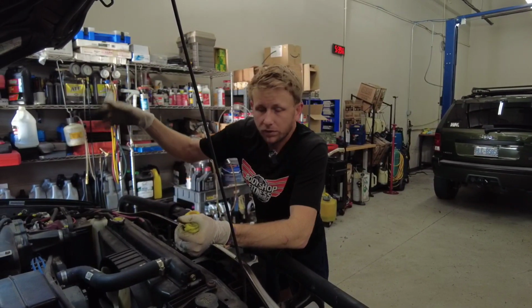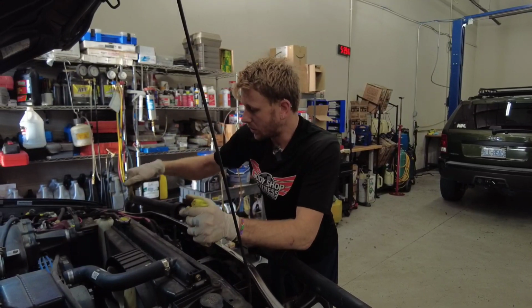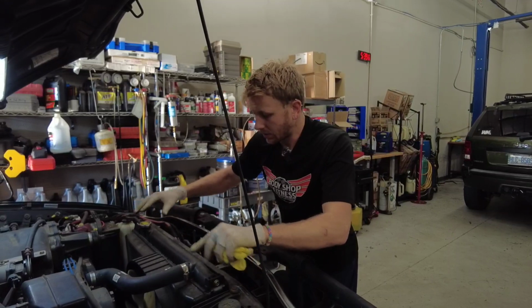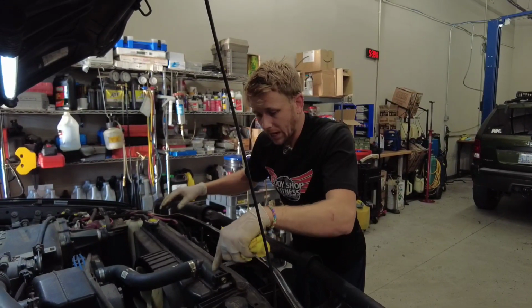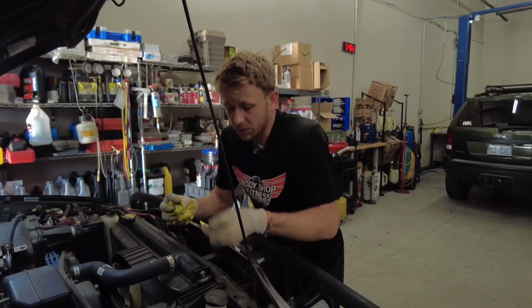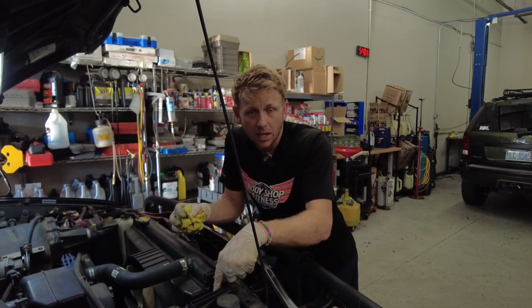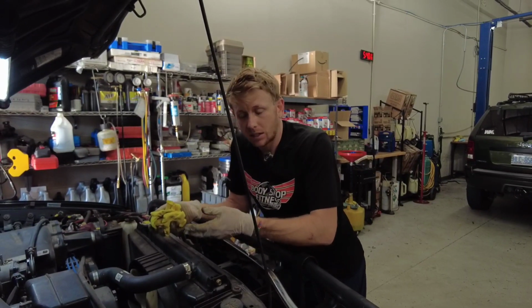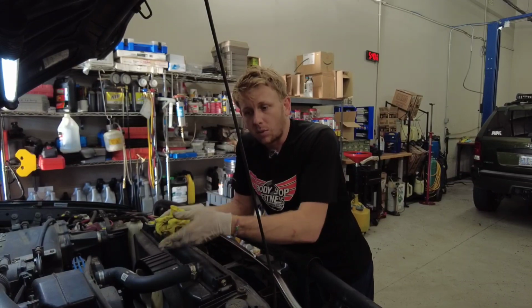It can pull out brake fluid, it can pull out coolant. Like if, say, the radiator here, the cap was over here and the plastic portion went down that way, and now we're going to change the thermostat. I could stick that straw down here and suck out the coolant. That way it's less of a mess when I go disconnecting hoses or thermostats or water pumps.